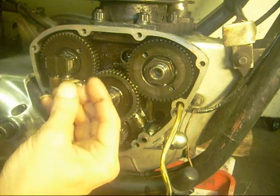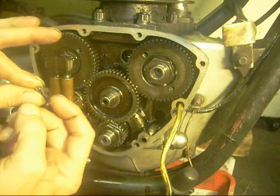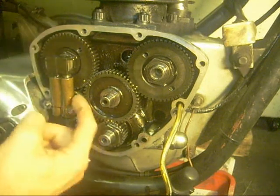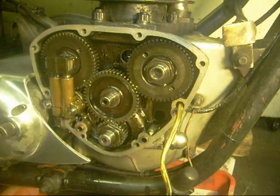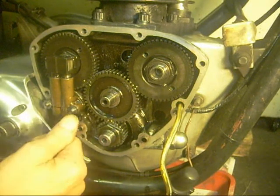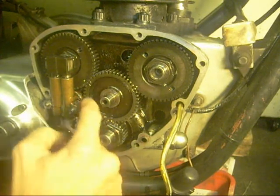The oil pump nuts — the special tapered nuts with a tapered washer. I noticed the new washers have the springs on the outside, but on the original ones they're on the inside, so I've used the original spring washers with new nuts. You must use the proper tapered nuts. I modified that gasket — used the ball bearing trick, put it on the pump, twiddled it to get the mark in the right place, and cut off the excess that was hanging inside.